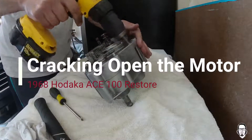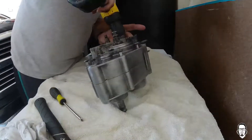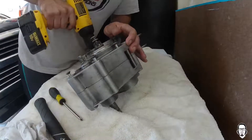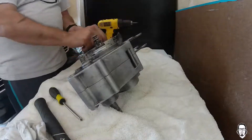So while I'm doing that, I'll show you what I found when I opened the engine and what I found clanking around in there. Crack open the case on the Hodaka motor — just remove all the screws that hold it together. Then you're going to use a little bit of force to crack the two pieces apart. You'll see the split and the seam right down the middle; that's where you've got to pull it apart.